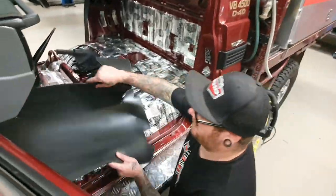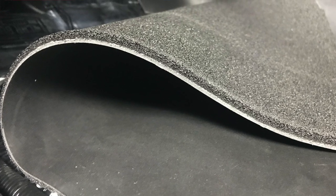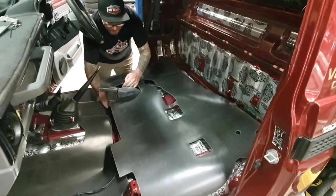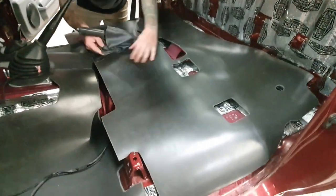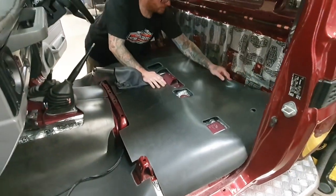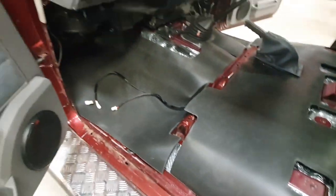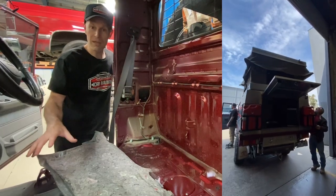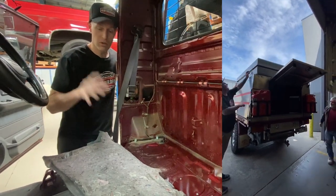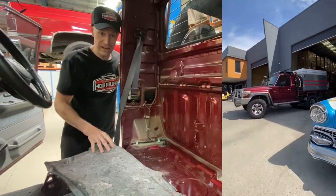This is used as the underlay throughout this car. We're going to replace that with our sound barrier blanket. So in addition to the dampening, we'll also run a sound barrier across the floor. What our four-wheel drive guys love about that is the fact that it then becomes a removable underlay, and it's not going to soak up and hold water. We get these in here that have had water in them — they stink. The only way to deal with it is take it out. We put something in that works as a sound and heat barrier that's also removable. We've ticked the box that the car can go and get used and abused, however you want to use this active vehicle.